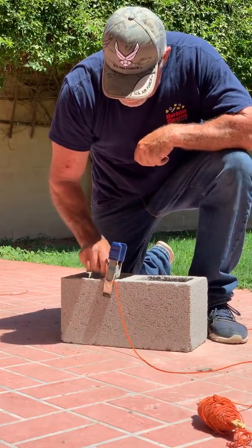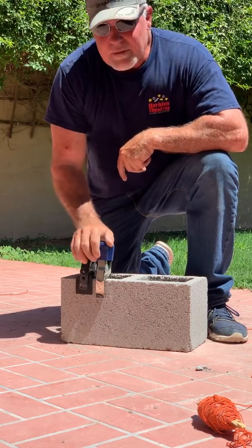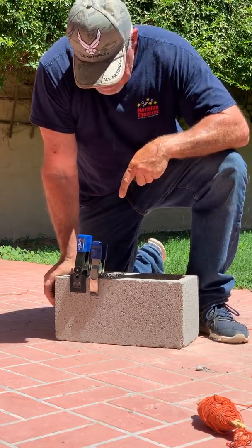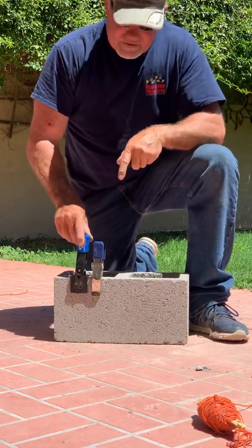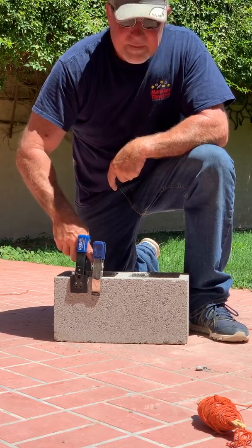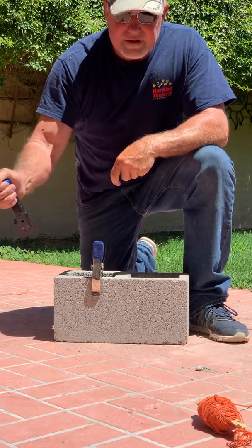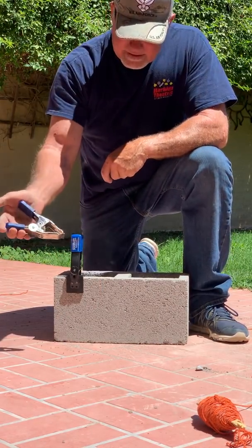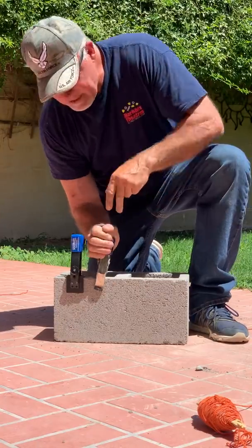So that's it — here's the Stay Put clamp, and here's the competitor's clamp. They don't want me to say their name but we all know who they are. The Stay Put bites down further. If you go to one of my other videos you can see where the spring is significantly bigger and stronger. I used a dynamometer — a hand grip tester — and this competitor spring is about 33 pounds of pressure to compress all the way down. On mine, 44.6 pounds was the lowest I got. So 33 versus 44 — you can guess which one's going to stay on the block.